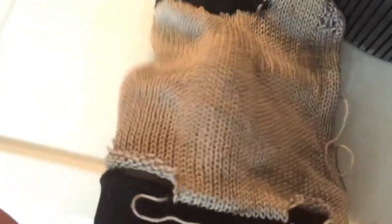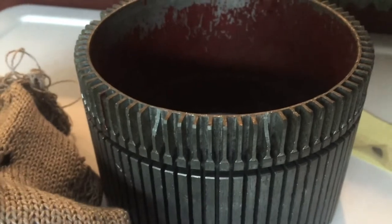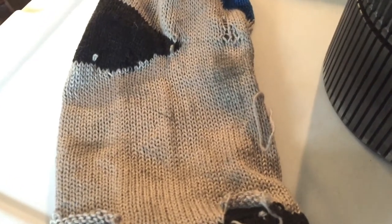Here's an example of a tube of fabric that I knit using the 80-slot cylinder. In the place where there's chips — and I can tell exactly where these two chips are — you can kind of see two rows of stitches that are closer together than the rest. You can tell exactly where that is because it happens to be on the cylinder where the two chips are close together. As those two needles come together, it creates a slight variation in the fabric. We're trying to refurbish the cylinder so that those needles stay separated, and there's no inconsistency in the fabric.